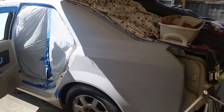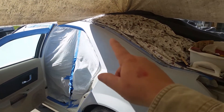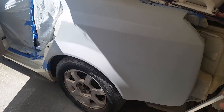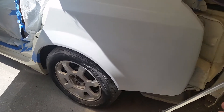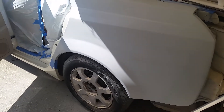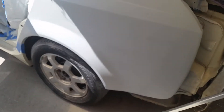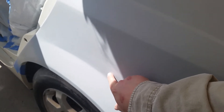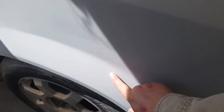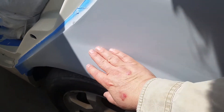It's Saturday morning and we're back on it again. Yesterday we worked on this area down here a little bit, up here a lot, and a little bit right down here. I want to show you the results — one of the reasons I like to use primer after working on an area is primarily to keep moisture off since we're outside, but also the next morning I get to see the shadow results. You can see I've got a built-up area right here and a little valley here, so I really need to hit this with some 40 grit. This has a nice transition but right here it gets a little sharp, so I'm going to have to use my round tube here.